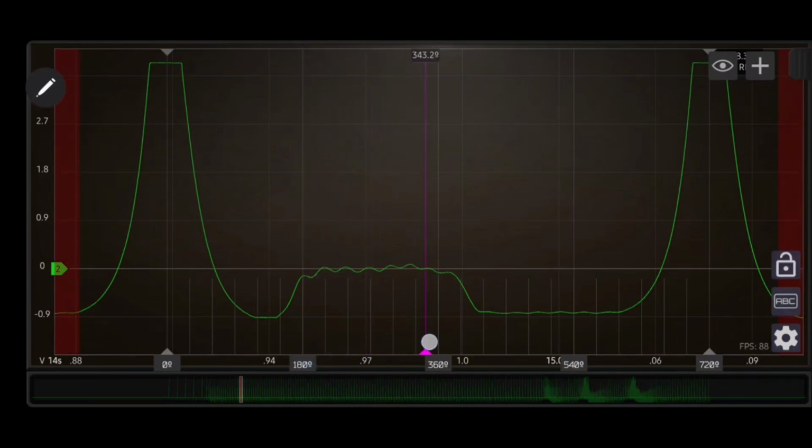Now, if you come over here to this top dead center line right here, you actually want this top dead center line to be pretty close to the point where this intake valve starts to open, because this downward strike right here is when your intake valve starts to open. Now you want this top dead center line to be pretty close to that. So in all honesty, if you ask me, this is a little out of time too, because you want it somewhere into here. So I'm going to have to say that's probably a good 5 or 6 degrees off also.